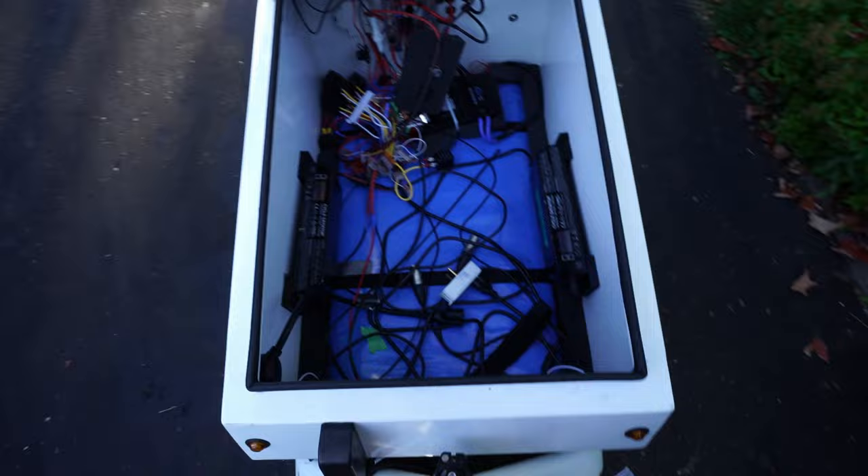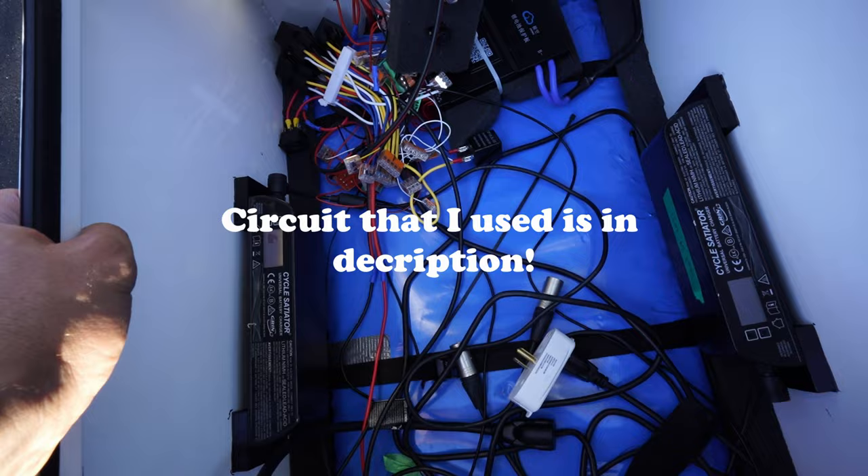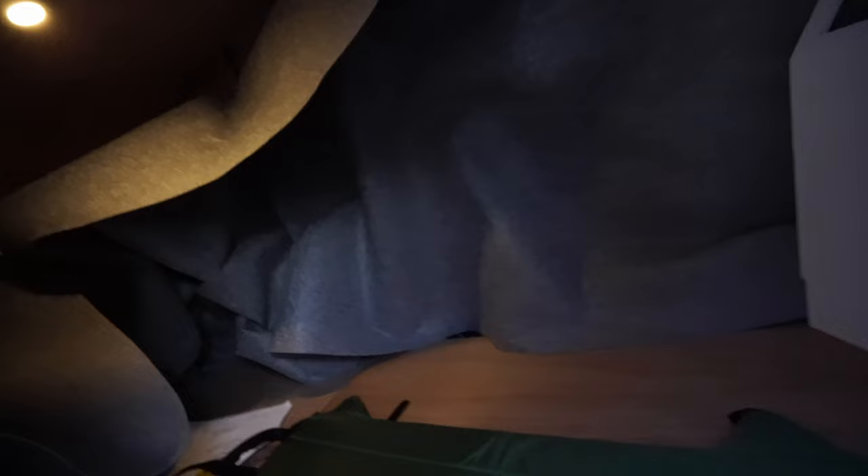Entry points for the horn and motor power cables going from the phase runner controller into the box and to the battery. Also got some updates here — I know it's a mess now but I'll clean it up soon. I've got this relay network taking my rear brake lights input from the cyber drop, running it through there. My brakes work and my turn signals work. For those of you that are very concerned, I have fused everything — I've got the main breaker and fuses to each circuit. I'm going to use my staple gun and quarter-inch staples to staple it up temporarily, then 3M77 spray glue it down in sections and remove the staples afterwards.